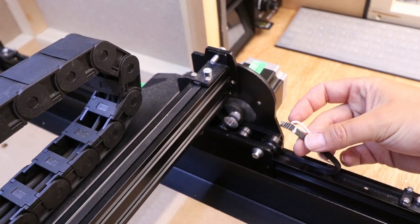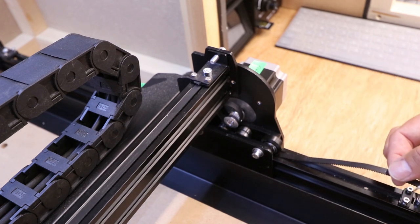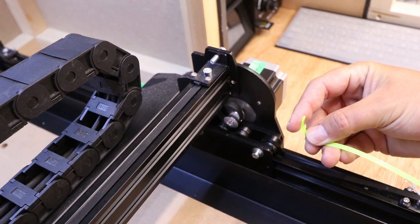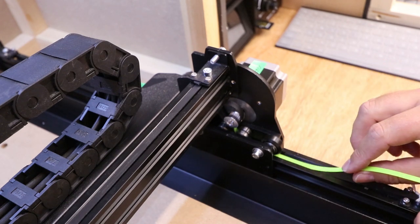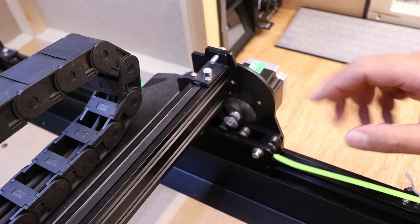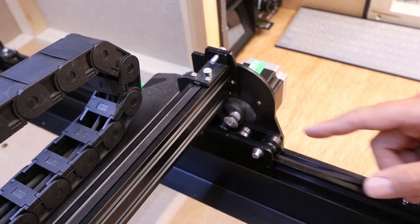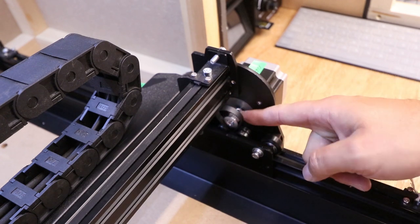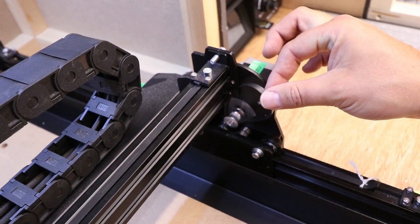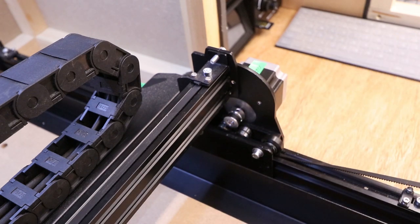If for any reason the string becomes detached from the belt as you're working through, or maybe you didn't attach a piece of string to begin with, there are a couple of options. Consider something like a zip tie — put a slight kink on the end and feed that through to catch the gap between the bearings. Equally, a piece of copper wire may do the same thing, but be careful not to damage anything since it's metal. I would avoid disassembling anything if you can, but you could release the set screws on the piece here, take it off, and it may give you a little bit more room to pull the belt up through the gap in those bearings.